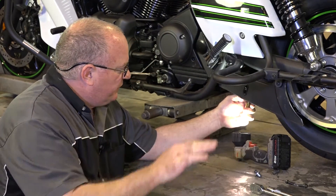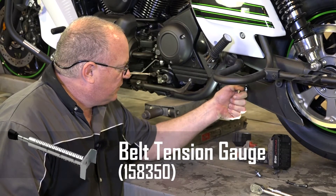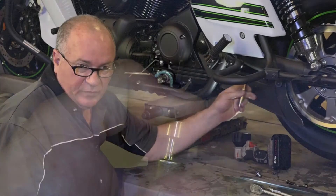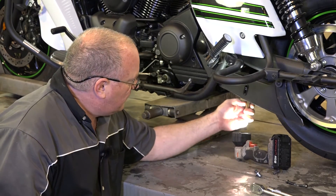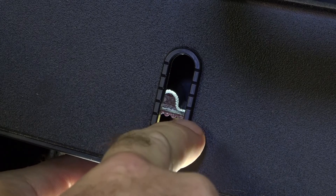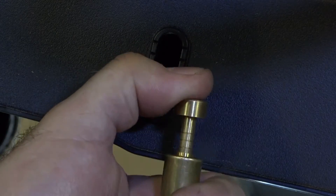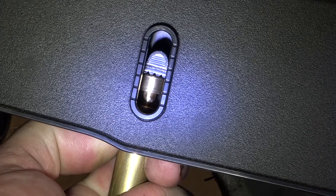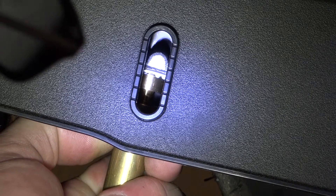Here's how we get this done. We've got the back of the machine lifted up and we've got this little tool right here. What this tool does is it's gauged for different pressures. That right there is going to be 45 newtons or 10 pounds, and that's what we need to check this particular belt. What you do is mark with your eyes where the belt is — right here. We're going to put it in the center of the belt and push up until it's aligned with that mark. So, center of the belt, push up. Now you want to see which mark it is on this guide — it moved up one notch from here to here.